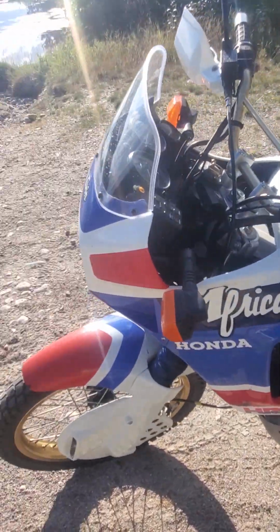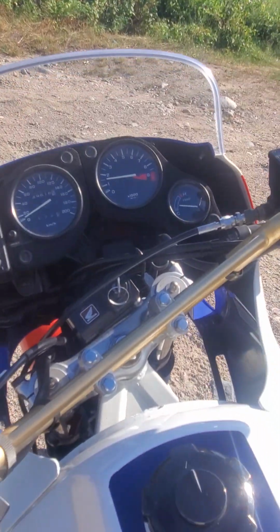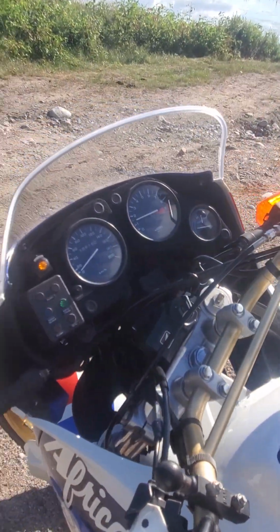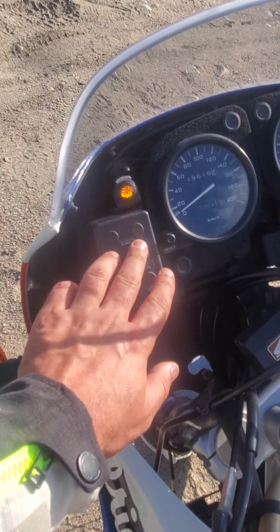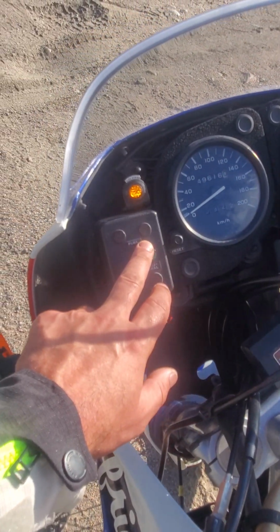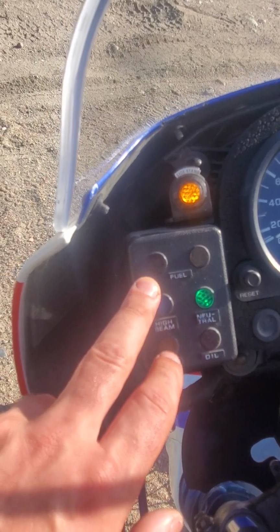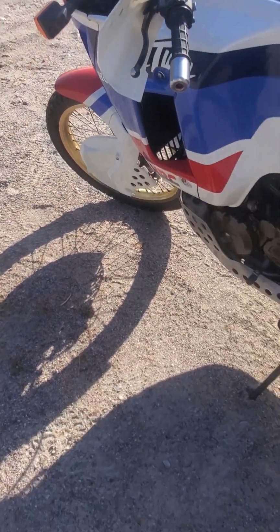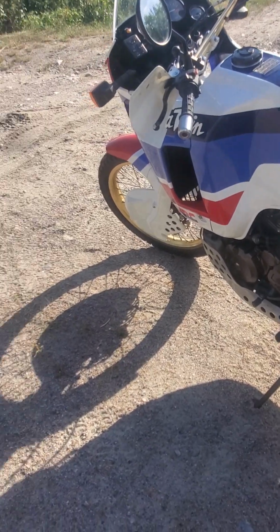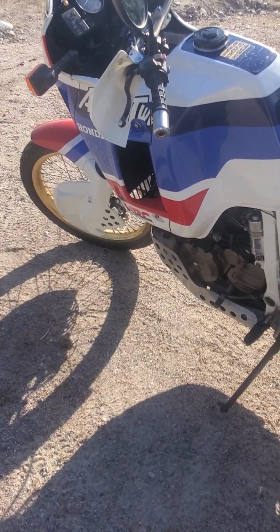But you know, like Honda, pretty much everything works on it. But also like Honda, one thing that doesn't work is the thermistor fuel sensor light. So there's a half tank done light, and then there's a low light, and only the low light works on it. And that was after I replaced it, because they're quite expensive, and I don't really need it. You don't want to trust them anyway.